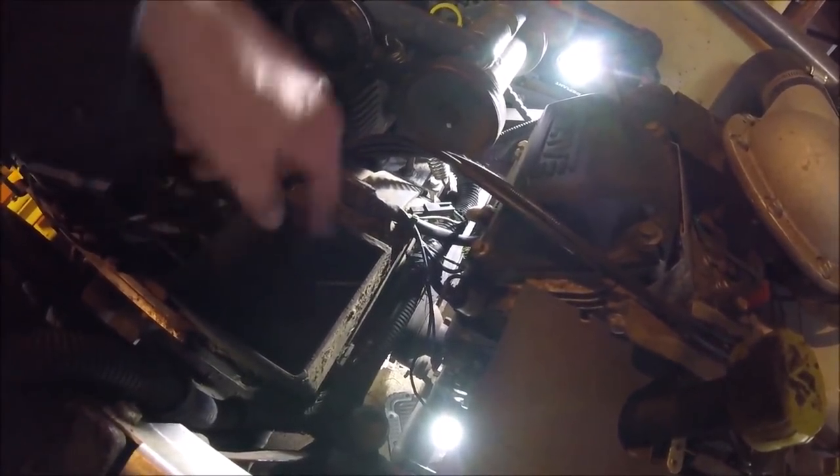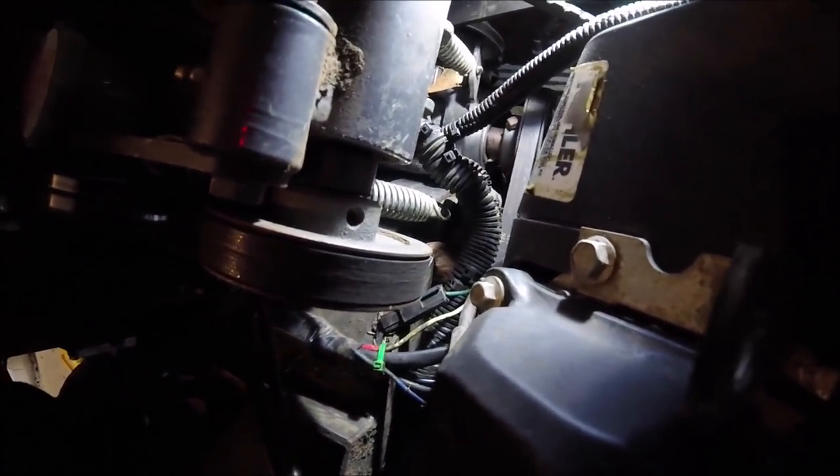Like, when I lift that belt up and down I can rock it back and forth. Now, see — this is pretty tight, it doesn't spin. See, when I push it back, this thing should spin this way, because it grabs all the stuff on the fins and shoots it straight up. If it spun the other way, it would just push everything down. So it spins this way when it's going and throws everything up. But when I push the blower that way, my tension pulley is going down — it's pushing my tensioner pulley down. And it's taking the... watch the belt lift up when I push it down. See the belt lift up? It's not staying tight on there, which is what it should be doing. It should be staying tight on there to spin this at optimal tension. And it's not.